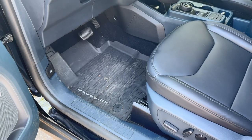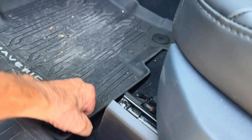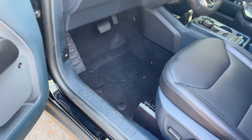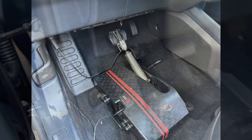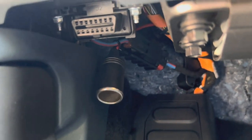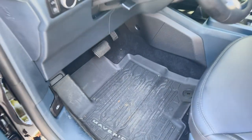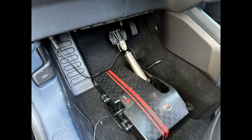The RVI3 sits on the floor of your vehicle in front of the brake pedal. In the Maverick, you must remove any floor mats for the RVI to have a sufficient place behind it to rest against. The arm attaches to the pedal, and then the unit slides back to find a resting position with support. The brake must have an always-on power supply. There is not a good source for the power within reach on the Maverick, so you will need to supply one. Mine is installed here and is out of the way when not in use. The brake has audio instructions for further setup.